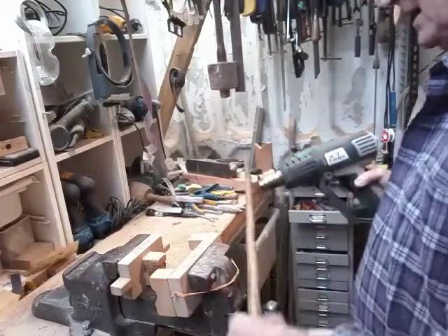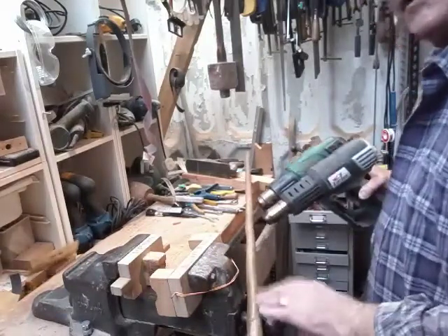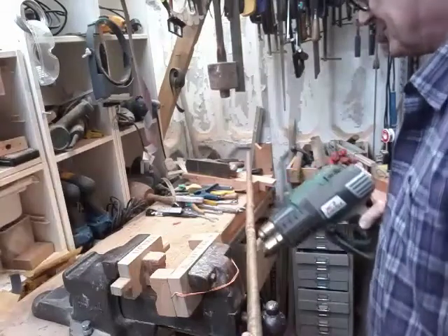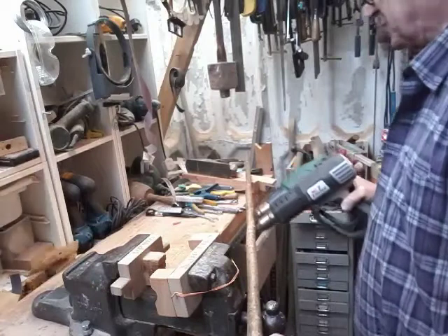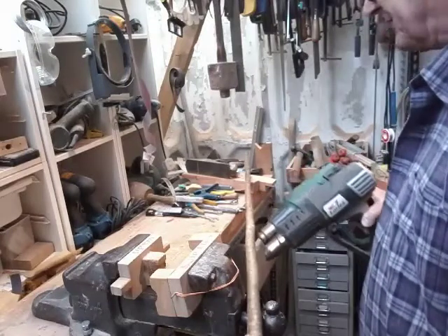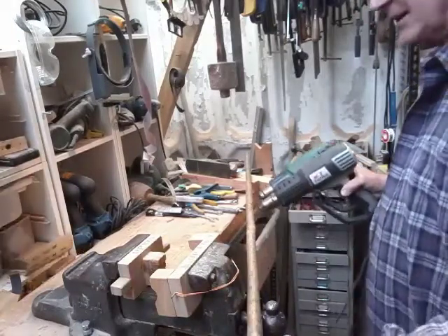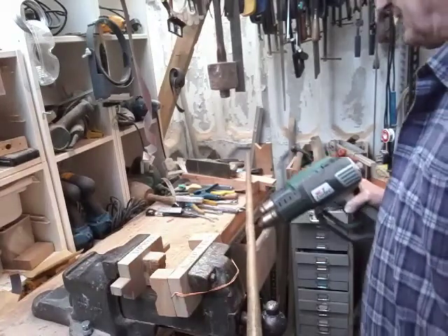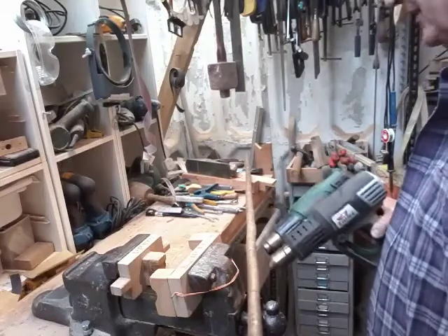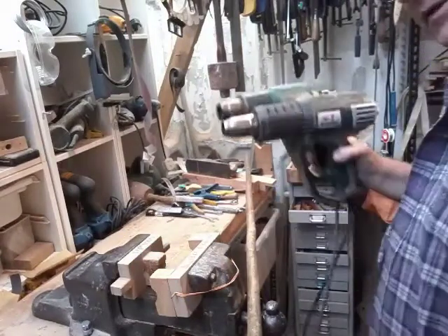Normally if I didn't have a camera here, my shank would be lying on there and I'd be heating away — so the vice is a very good little notch to rest your shank on. Keep the hot air guns moving; you can impart heat without scorching the bark. The idea of heating the timber is to soften the fibers, which makes them pliable so you can then put pressure on the bend and straighten it up. This technique has been used for millennia — ancient man used to heat his sticks over a fire to make arrows. We're just doing what's always been done, but with modern technology.